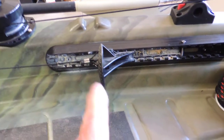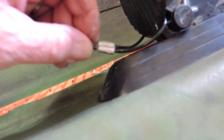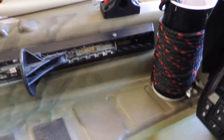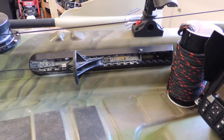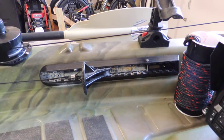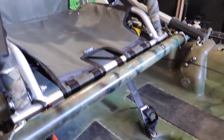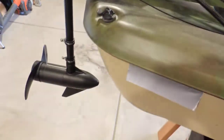I connected a cable to each pedal. The cable is a steel cable coated in a very thin rubber coating — this is some great stuff, extremely strong and slides really well. To keep from over-steering the motor I added a pedal stop on each side, which is nothing more than a screw, but it keeps you from turning the motor too far left or too far right. I have mine set where it stops at about three o'clock and nine o'clock. If you go past those — say to four or to eight — you're actually going to reverse the boat, and that's not something that you want to do.